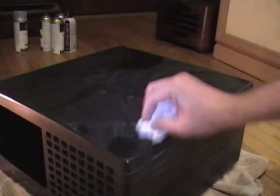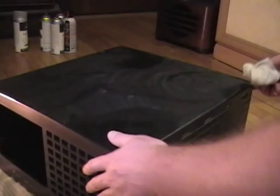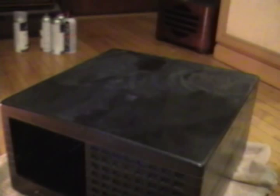I can already tell this is still really rough. I think I will go with wet sanding on this, but unfortunately I don't think I have the right grits on hand — I'm down to only 1,000 grit and I really want to go up to 3,000, so I'll have to do a little shopping expedition before I can try wet sanding. In the meantime I'll keep going with this.